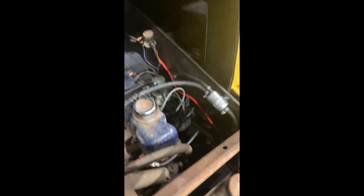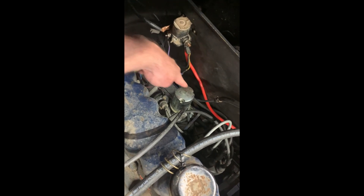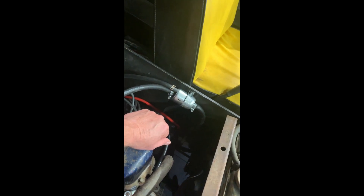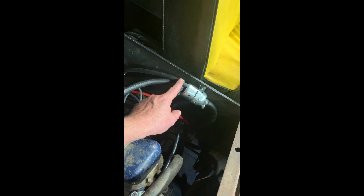Let's get a glimpse of the top side of the fuel return lines. You can see here I've got the hard line just coming up off the frame, turned it up and attached a piece of rubber hose to it, took it over to the new fuel filter that I've mounted over here on the side of the doghouse to get away from the heat a little. I've got the supply line coming in from the fuel pump down there.